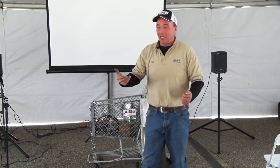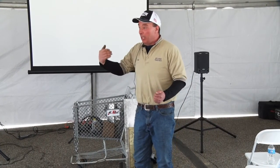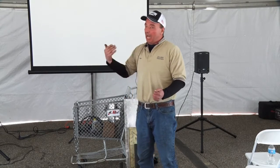It's an assist. Matter of fact, if you put too much brake in it and you get in a panic stop, you might jackknife. People think it's the opposite way. It is not. If you take a CDL course, because you have to, you'll learn that when you take the class. Too much rear brake will cause you to jackknife. So that's why it's critical not to have so much rear brake on these.